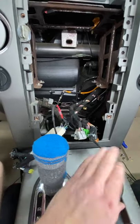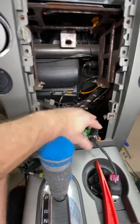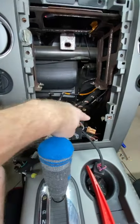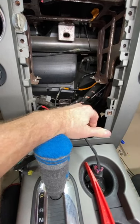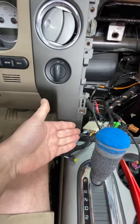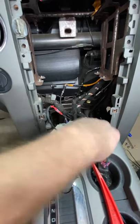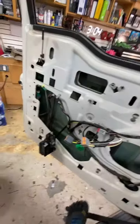So we've accomplished the same thing, but now we're using the right power source. We're not using this accessory to power that cigarette lighter. We're using the actual cigarette lighter. So if you blow this, you're going to blow the same fuse that's in the car, because they're connected. It's not going to blow out your radio, so that'll be nice. And then you still get the same fuse rating. If this was rated for 15 amps, it's still 15 amps, because this might be only rated for, let's say, 10 amps. More than likely, this is probably like 25 amps. So that's why you add a relay instead of doing something silly like they did. Oh, goody, right? Now we've all learned and had fun. Look at that.